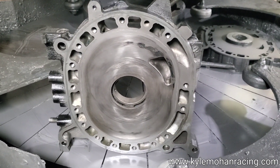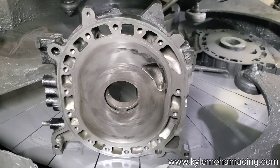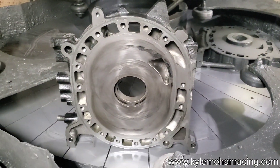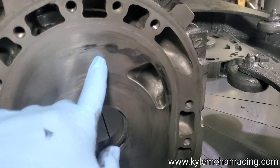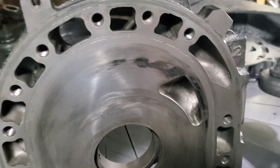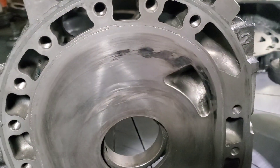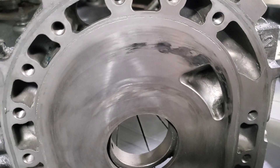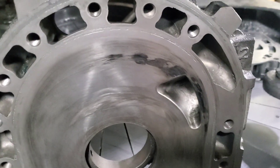Personally, just like piston motors, I wouldn't consider it a proper rebuild if parts weren't either replaced or lapped, because especially in this case you could not put that back in there. There's always the possibility that the burn has gone too much and there's shrinkage, metal conditioning problems, or even cracking. So when we lap a component that's had damage like this, we're very careful, looking at it. We've even sent housings out for crack checking to make sure there hadn't been any damage we couldn't see.